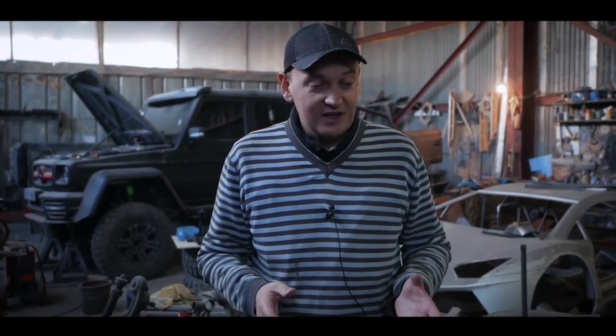So, it's time to clean and make our gimbal good. It is original from a Volvo Laplander. The condition is just brilliant. We checked the axles and their mileage is about 10 to 20,000 km. It's nothing. But because they are in oil and old paint, we need to clean them. So we're going to clean it off, prime with epoxy and paint it with black polyurethane paint. Then we will lubricate the cross piece and spin it apart and it will look like a new one.